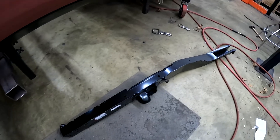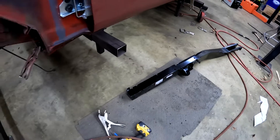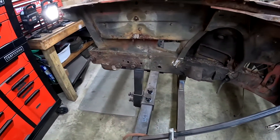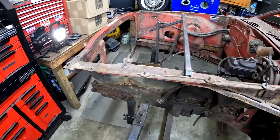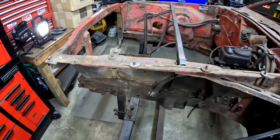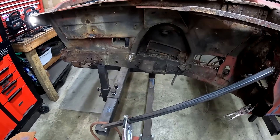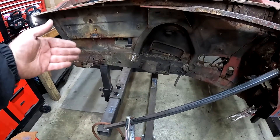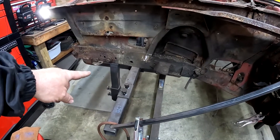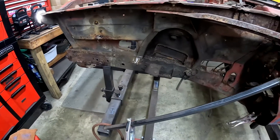It's a pretty good repop from AMD. The nice thing coming is this frame right here — I went ahead and braced it. Took measurements throughout, all the way up and down. Took photographs of everything, and I'm about to get out the plasma cutter. I think I want to take it straight out this way instead of trying to drop it down, so I don't have to move this brace and everything can stay in line. That's where we're heading next.